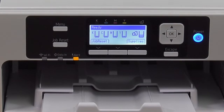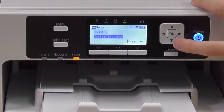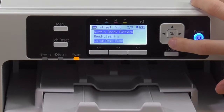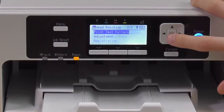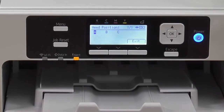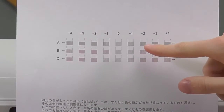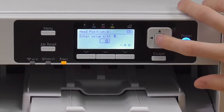To enter the adjustment, click Menu again, then Printer Features, List Test Print, and scroll down to Head Position Adjustment. Click Adjustment, then High Speed. As you can see, the most straight line on A is zero, so for A we're going to click zero and click OK.